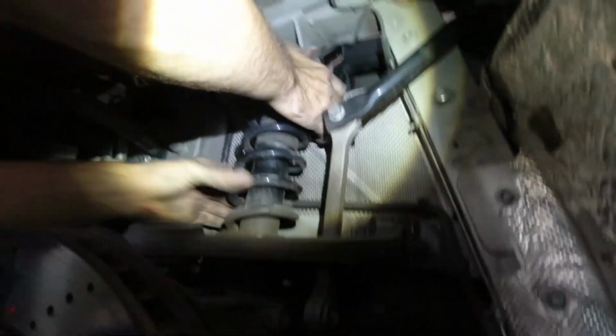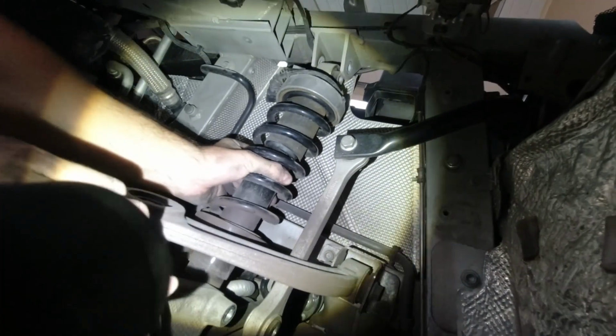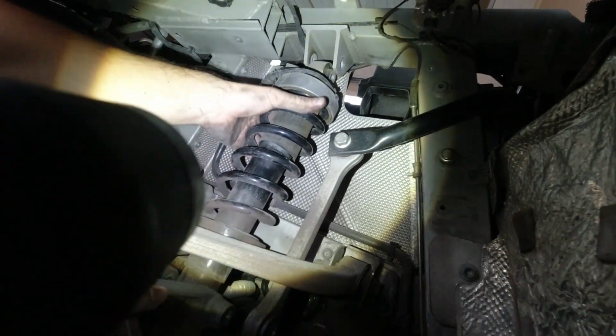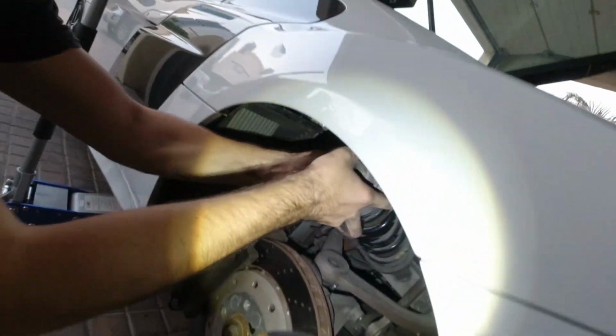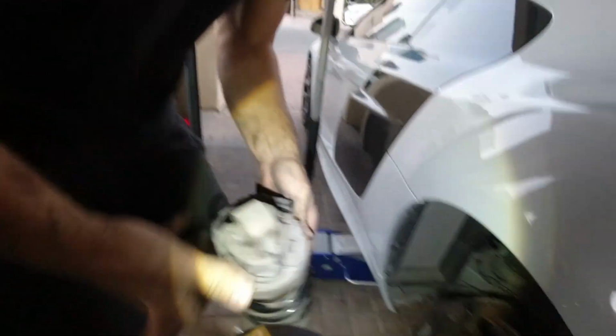Out the rear shock now, got all the bolts undone. You do have to unload the bottom one with the wishbone, but let's see how this goes. Was that a bit leaky there? Yes. Okay, so that's how. It looks like you have to pull it towards you from the top, and that's the first rear shock out. The leaking shock is this one, so that's left for last.